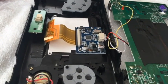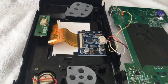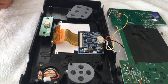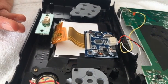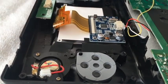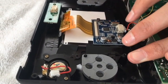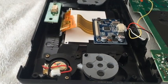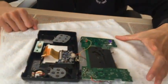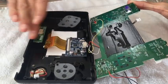I have the wiring harness plugged into the board and it's still floppy at this point. Once the tape is in place, you're ready to mount the board and start buttoning everything up. If you have double-sided tape you can use that, or alternately you can use hot glue. Put the hot glue or double-sided tape on the back of your controller board, then push it as far against the case as it'll go without crimping the harness, and firmly push it down so it's set in place. Make sure to tape the back of the board so that nothing touches and no metal shorts out anywhere.